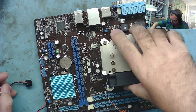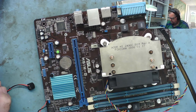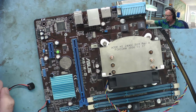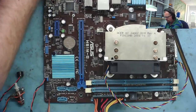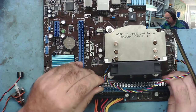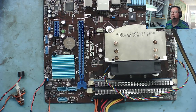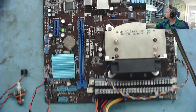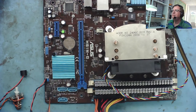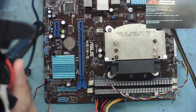Let's see if it boots and bleeps. There's a little speaker — there it is. Okay, let's see what it does. Power's on... we power up... it boots and it bleeps — no RAM! Okay, let's stick some RAM in there. Let's connect the monitor and see what happens. Power on, booting — do we get anything on the screen?